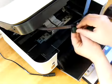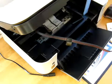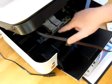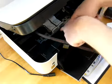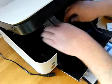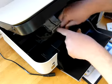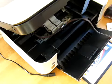So you need to remove the green backing tape from your clamp. And then if you look here, you've got a little ridge here, and then you've got another small flat surface just at the bottom of this, and then it goes down again. So you need to put this clamp in the centre of this small flat area and push it down firmly. Alright, so that's the placement of the clamp.